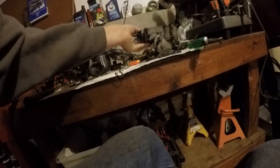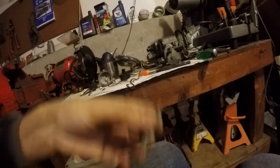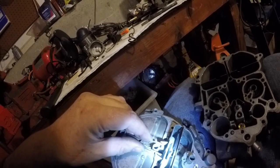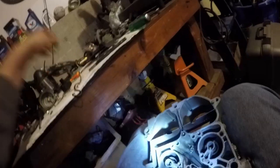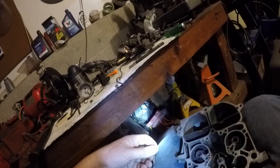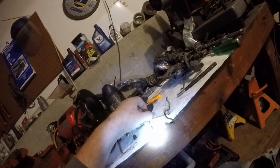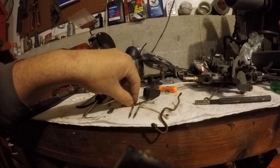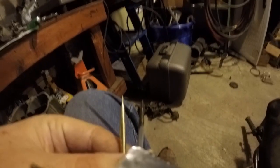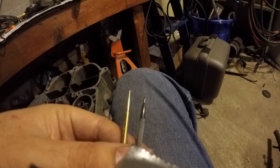The only other thing that's pretty different is these secondary metering rods — this is the top of the carb. These just sit on top of here, and the T-metering rods dangle from this thing, hanging through the top and sitting right in there. When the flap on top opens, it pulls them up. For the turbo application, Cliff told me these are actually the richest ones they ever made. He put them in foam because they're so thin he didn't want them damaged — he took a stock set and machined them down for me. Look how fine the point is on this thing. It's quite a bit richer and the taper's different too.